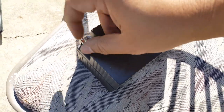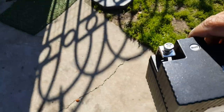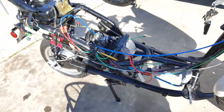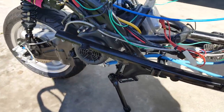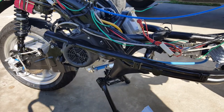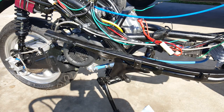Whew. It's getting warm now. I feel like it's almost time to put the adhesive on. You definitely want to apply adhesive when it's a little bit warmer, room temperature. If you really want, get a hot air gun and warm up the metal a little bit before you apply the adhesive, so that's even better. But I think it's fine. I'm going to take off my jacket because it is getting warm. Okay, so let me prepare to have this sit here. We're going to start washing it down with some brake cleaner in the area. Does it eat up paint and anything like that?